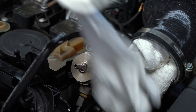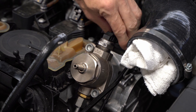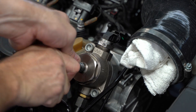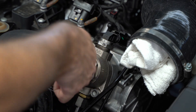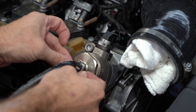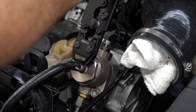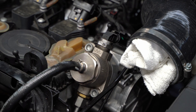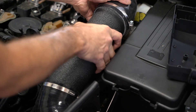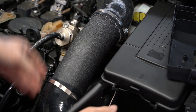I was just careful when I removed it and re-centered it in that brass fitting as I installed, and it went right into place. I tightened it up until it's tight, then plugged back in the electrical connector. The last thing is to put the fuel hose on — this is an Oetiker clamp, a single ear clamp, and I have a tool for that. Do not reuse that spring clamp — the number one problem is that hose popping off and fuel spraying everywhere.